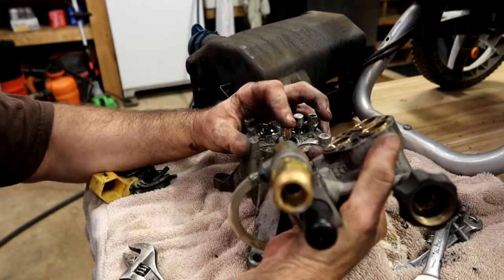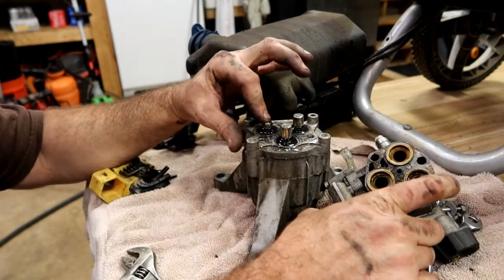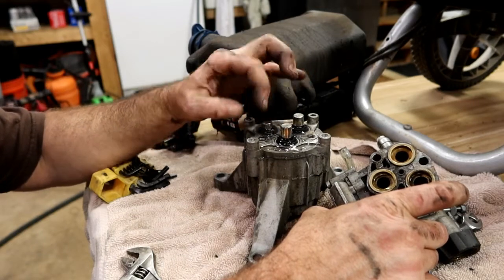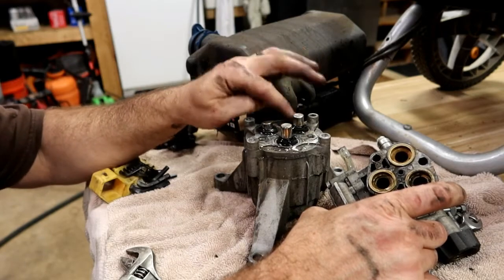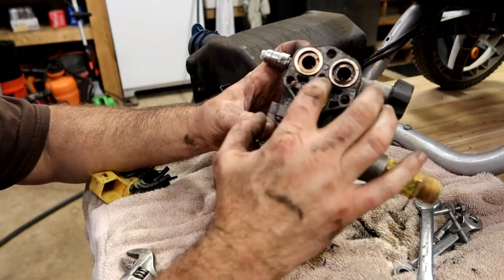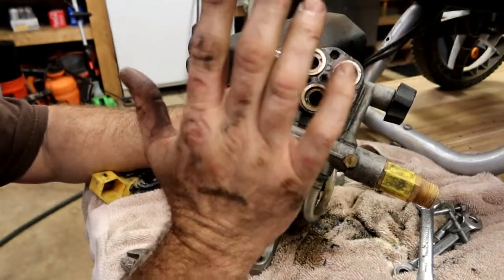Okay. Yep. These are your valves. So that wobble shaft, as it's spinning, is pushing this one down, this one up, this one's halfway, then as it spins around, this one will pop up, this one will push down, that one will go. So these are just basically up and down, right? In here there's water passages, I think with check valves that allow the water to build pressure.